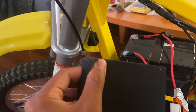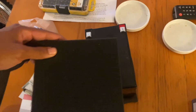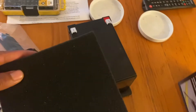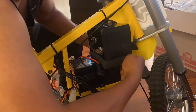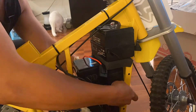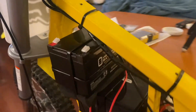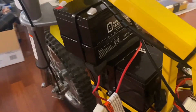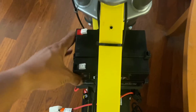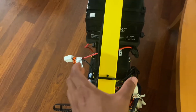The reason I'm putting one-inch dense foam between the top two batteries is you do not want to cause damage to the wiring or the terminals. I'm going to trim this piece to completely match the dimensions of the battery. The dense foam keeps the weight evenly distributed across the top of the third battery, keeping pressure off the terminals. You'll notice the battery sits about a quarter inch closer to the right side of the bike because the battery tray itself is slightly pushed over to the right.